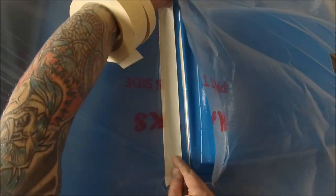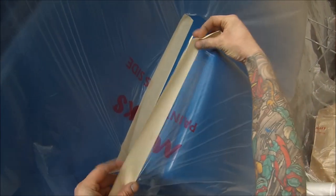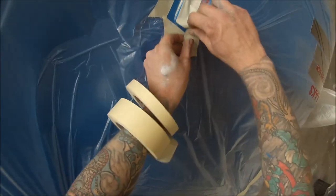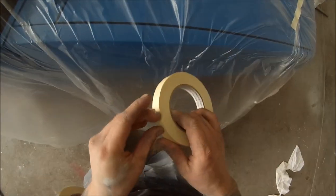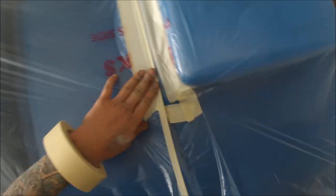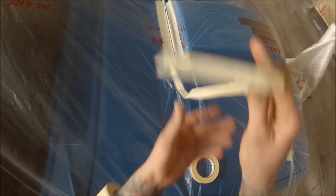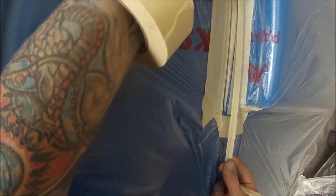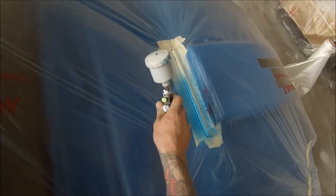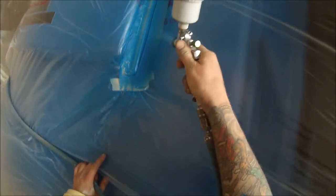Now doing the paint work on here because we've got that exposed seam sealer. Just masking out — just a little strip. I'm leaving the masking a tad off the edge and then I'm going to be using what we call a false edge. I'm getting a piece of thin tape — three quarter inch tape — and then flipping this edge over as you'll see here, then running it out. The entire piece will have a false masking edge which we can then put across there, and we won't be left with a big thick edge once we paint over it. Now I've got the base coat colour in my gun here — just spraying over it. Dry it off with the air in between coats or a heat gun, and it won't take long at all. Just put a couple of coats on there to make sure it's covered. Next up we're putting our clear coat on — given the gun a quick flush through and put some 2K clear in there with a bit of activator — some rocket — which just makes it dry a bit quicker.